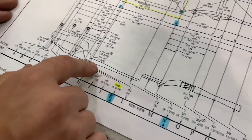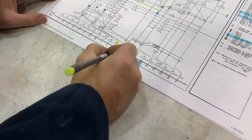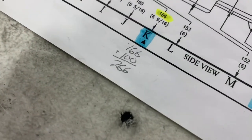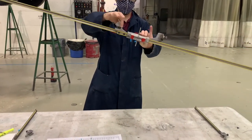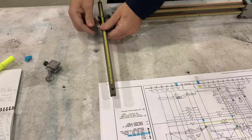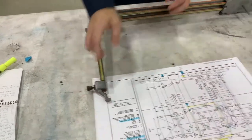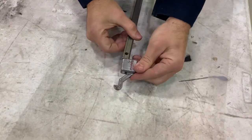To use the centering gauges we're going to refer to the parallel-to-datum measurements, though I'm referencing the point-to-point measurements up top to set the first two gauges at those body zero points. My datum will not clear the vehicle, so I'm going to add 100 millimeters to each point manually — I've taken the measurement 166 millimeters and added 100 to get 266. To prepare the centering gauge, I take the gauge in my two hands and push both parts towards the center, which allows the gauge to center so when I pull one side out the other side pulls out equally. Then I'll insert the ends into the gauges so they can hang from the vehicle. These ends clip in here, and then there's a screwed section where I can screw the end in to hold those parts securely, and then the hangers go in the end as we showed earlier in the video. Use an appropriate hanger for the hole you're going into.